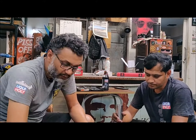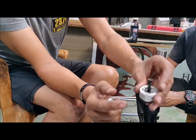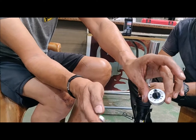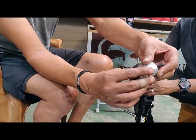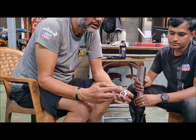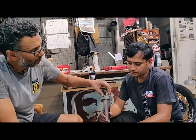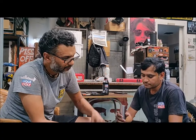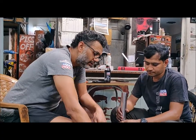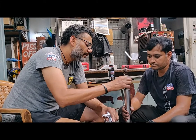Once the air gap is done, with the YSS suspension — which seems to be a really good upgrade — we have a little spacer and the valving that allows the damping. You can see the holes in it; you can adjust it, and it comes preset for most of us. We drop this in first. To keep it from spinning around, we apply a few dabs of grease to make sure it doesn't slip out of its slot. Then we drop in the new spring from YSS, which will naturally find its way down.